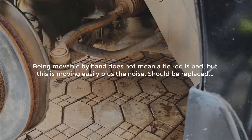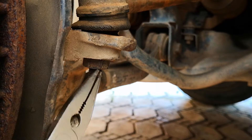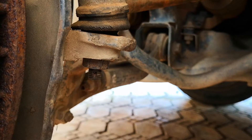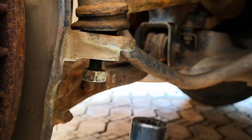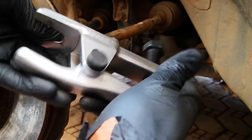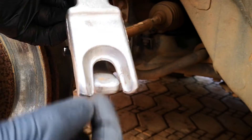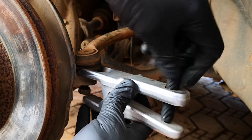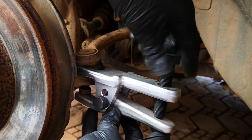It's not the worst case scenario. To take this out, the first thing you need to do is remove the cotter pin, then remove the bolt for the stud. You don't need to drive it all the way. Time to fit the ball joint remover — it goes upside down, like so. I'll need to loosen it a bit more so it fits under, and then you tighten it.